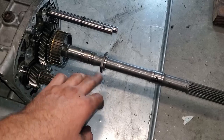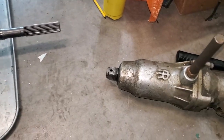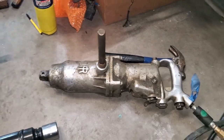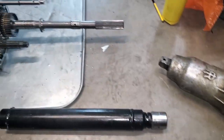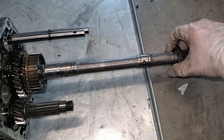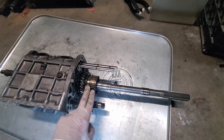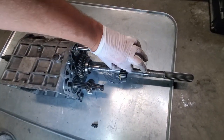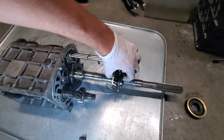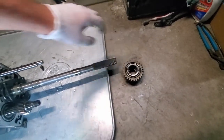We got this nut broken loose - it was on there so tight I had to use a one-inch drive pneumatic impact gun to break it off. We're going to slide off this flange nut carefully around the bearing surfaces of the main shaft. Now we're going to remove this whole reverse/fifth gear hub assembly, keeping track of where everything goes - sliding off the outer bearing races, inner bearing races, and the actual bearings very carefully.